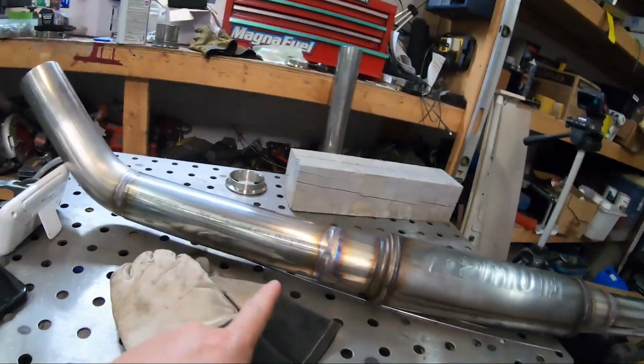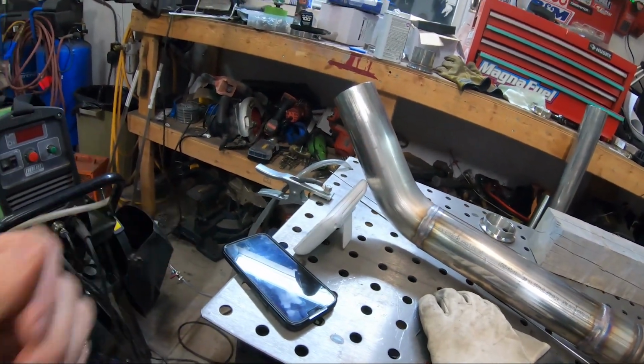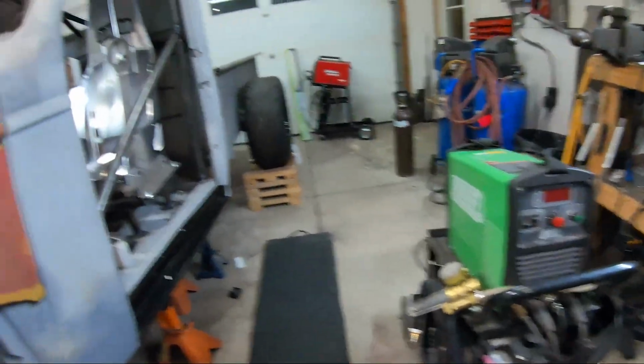So keep that in mind if you plan on doing this yourself. It can get pricey depending on how many welds you have to do. You're back purging, so that uses a lot of gas. So it adds up. Just fair warning, if you haven't done this before, it adds up. And we're not even done this side. We still have to do the wastegate. So